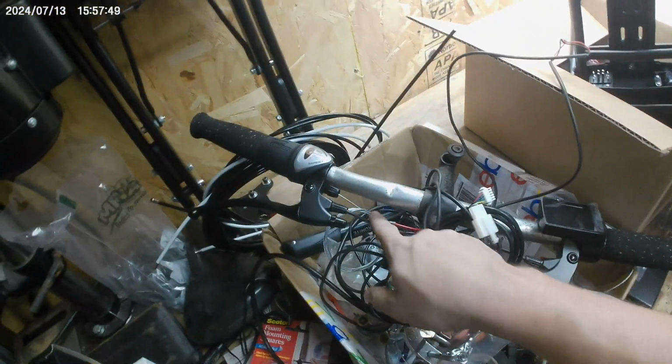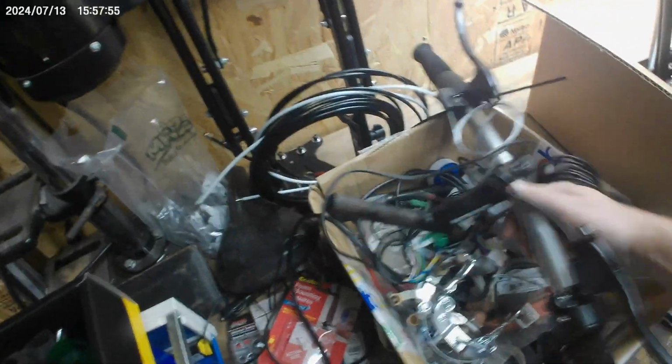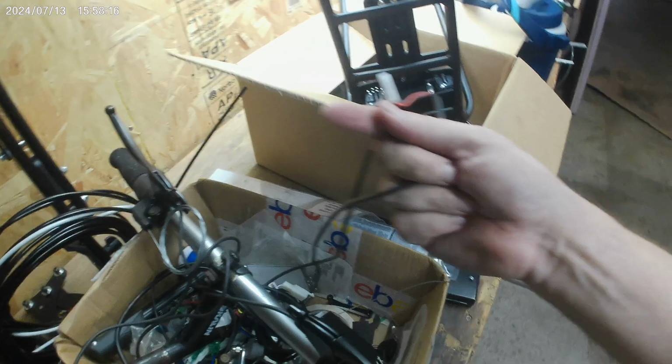I was trying to finish the mechanical part of the bike, but one thing I am inevitably going to run into is that these brakes, each of them has a sense wire, or you know, whatever you want to call it, and they join up at the very end of the cable, and that is not appropriate. So I'm going to have to take this inside, make the Y connection way up here, so that it's just a single cable instead of two cables running to the back.